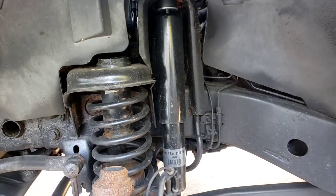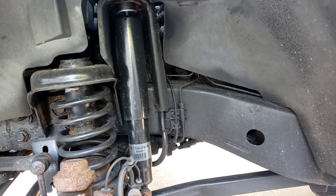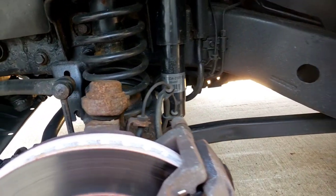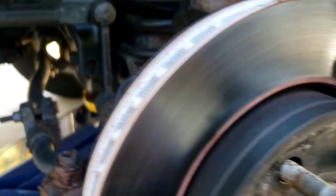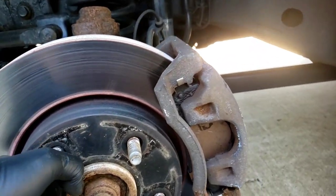I had changed the right front brake hose and caliper on this Jeep about four months ago. And look at this one — this one started to go too now. Look at the white ash that's on this rotor, because it's heating up so hot. And right now it won't spin by hand.